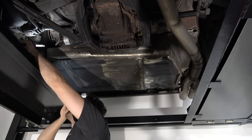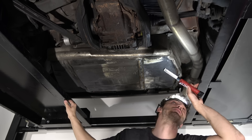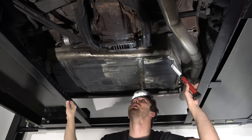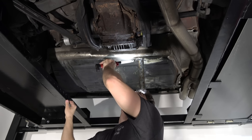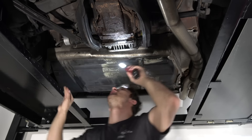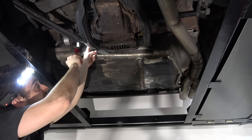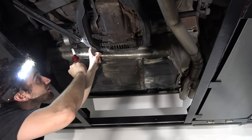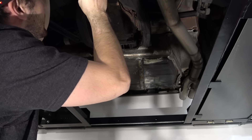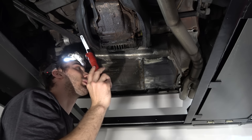Rear shock mounts are still in — that's a big E34 issue that a lot of people have been having lately, with shock mounts falling out, especially on coilovers. Mine look good there. The rear diff center bushing is good. My side ones, which I replaced with OEM because at the time they didn't have aftermarket, are actually starting to crack — so my rear diff side bushings are coming on their way out. My front one, which is the poly one from Lithuania, looks perfectly good. I don't get any diff clunk, so I'm not too concerned with that yet.